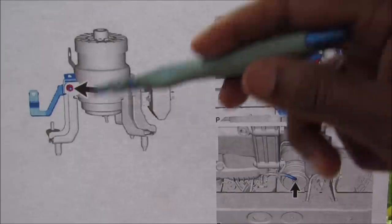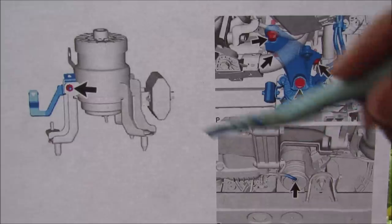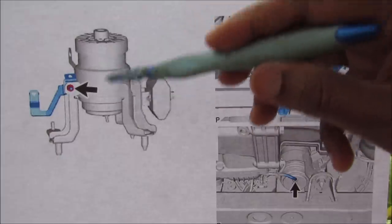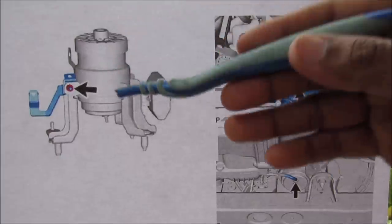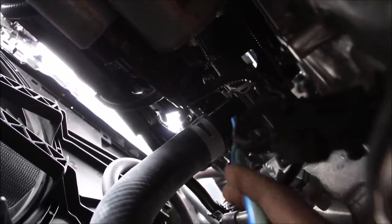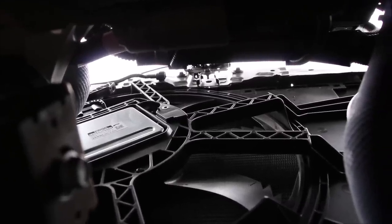Here's a look at that active engine mount from the side, top, and bottom. The ECU is going to vary the duty cycle of the vacuum switching valve in order to remove or add vacuum to this chamber, which effectively increases or decreases the stiffness according to the idle condition. Just to the right of the starter we have the lower radiator hose that leads to this plastic housing for the thermostat, and here's another look at the back of the radiator, the fan, and its controller from underneath.